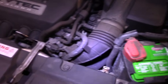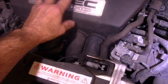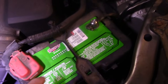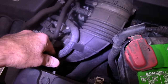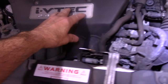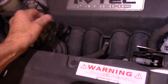Let me bring you over and show you where it is, and then we're going to get started. So the starter motor itself is actually located down in there — you really can't even see it, let alone get to it. That's why we need to take off everything you see in the front right here. The first thing we're going to do is disconnect the negative battery cable so we have no issues with any kind of shorts. Then we're going to remove this snorkel assembly, disconnect all of these plugs on the side, take off this cover here, 10mm bolts right here and here, remove that hose, and there should be another vacuum hose here and possibly a couple more down in there.